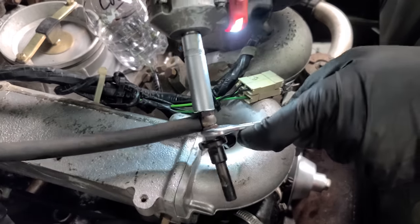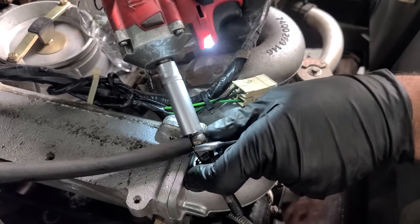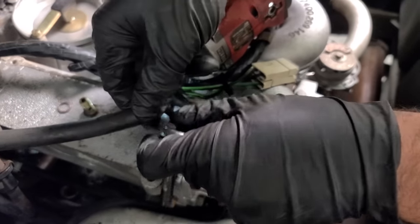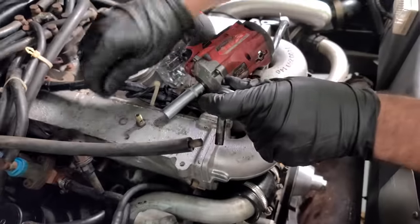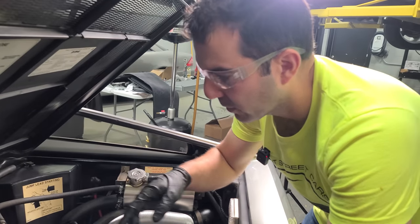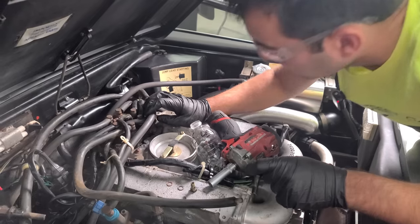All right, so we're gonna remove this loser injector. And it's 212s and there are seals here, and you're definitely gonna wanna replace these. So yeah, this fuel system has a ton of leak points. So 2 times 6 is 12. So we have 12 of those just at the injector. And then you have another 12 right here. Yeah, there's another 12 here.